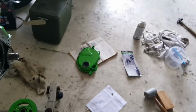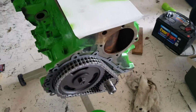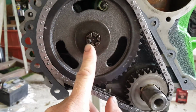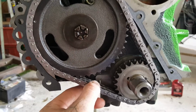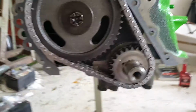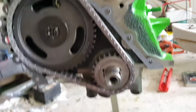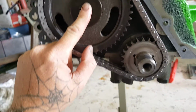So it's quite the upgrade. Whenever you install it, this goes to 80 foot-pounds. This is a 2000 Cherokee, going in a 2000 Cherokee engine. 2.5s are pretty much all the same, and as far as I'm aware, I have another 2.5 and it's pretty much the same thing. But anyway, this goes to 80 pounds torque when you torque it down.